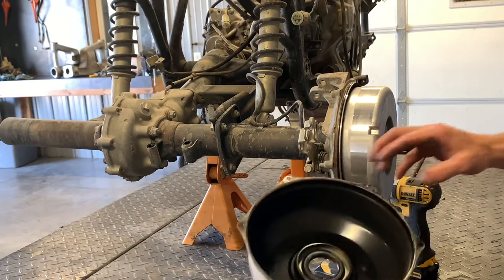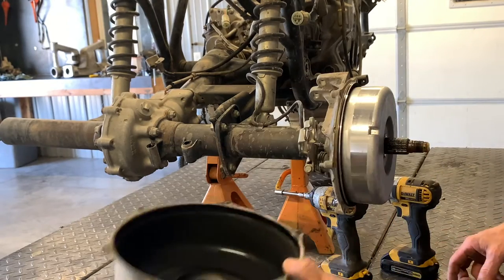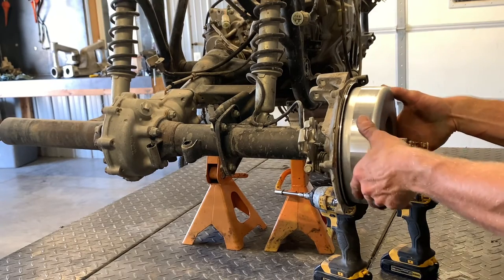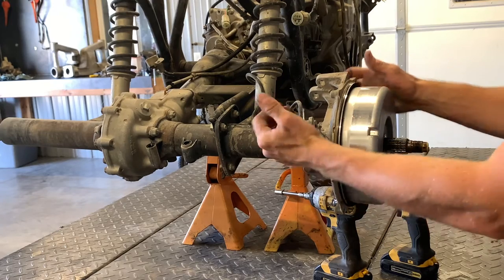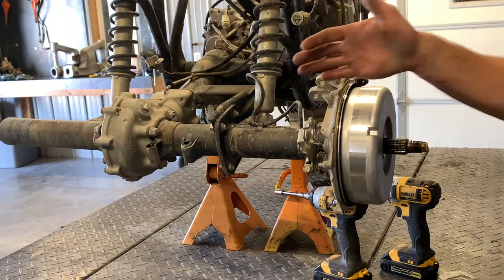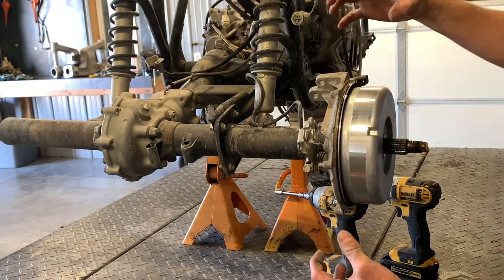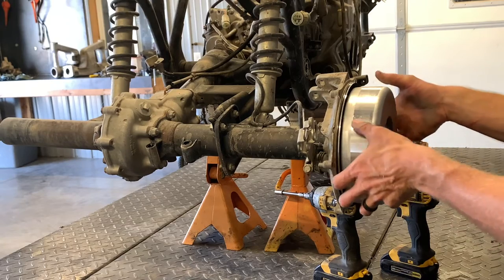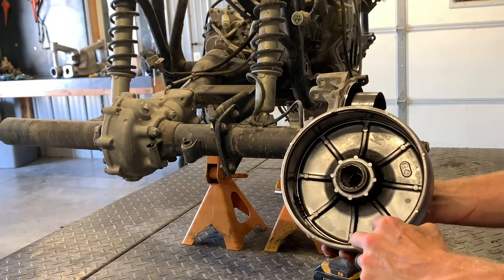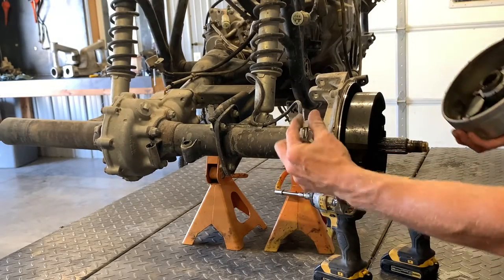Now the brake drum cover is off. If you've got a problem with water in here or see other issues, it may be the seal — that's an easy one to replace. Now we've got the brake drum. If your brake drum is not moving or not coming off, you may need to move this back and forth. If the shaft is seized, you might have to grab a hammer and tap one direction or the other, because it's expanding those brake shoes and not allowing the brake drum to pull off. You can see there's a little lip in behind here, and if those shoes are catching on that lip you're not going to be able to pull it off. You want to make sure this is completely centered.